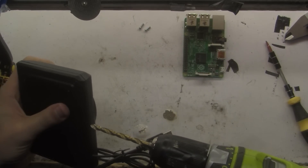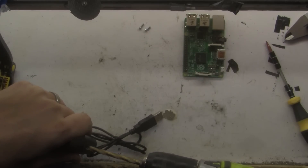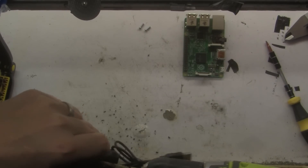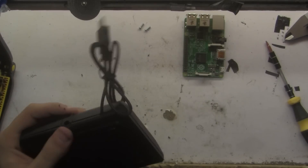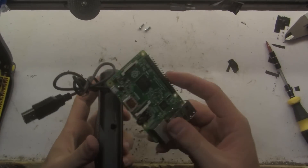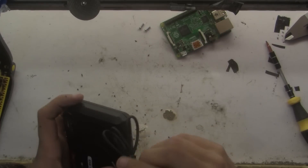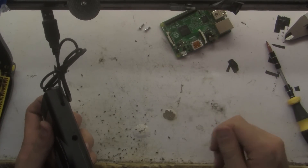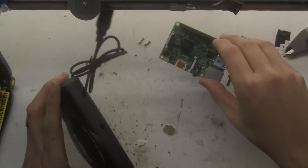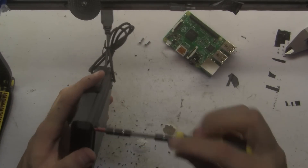Here's my drill and we'll just drill that out nice and slow, trying to hold the two pieces together so they don't buckle too much. Don't put any pressure on it — just let the drill bit do the work. Remember, don't go too deep because the USB hub is still in there; you don't want to take any chances damaging that. The hole's there — I can test fit and it's a perfect fit for the headphone jack. I don't really need the headphone jack but I don't want to remove it from the board or risk damaging my Pi 3, so I'll just leave it and make provisions for it.